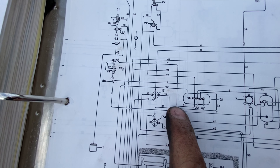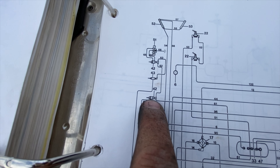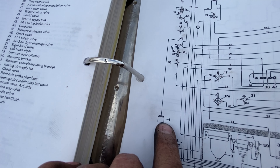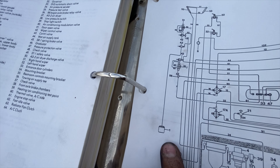So far I've got two that need some work, and I suspected those were leaking already. I know my windshield wiper motors are leaking, and my plan is to disconnect them and put in electric motors. I'm going to crawl under the bus at the front end, check around the air tank, and find out which lines control the pneumatic motors for my wipers — then just cap those off. Rather than going at it aimlessly, I used the manual that came with my bus. It identifies all equipment and airlines by number. It was a huge time saver, and you can still buy these manuals — go through some of the Eagle bus groups on Facebook to find them.